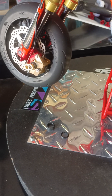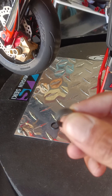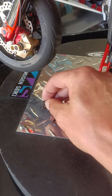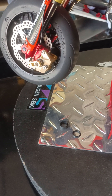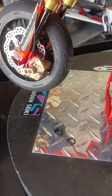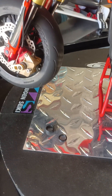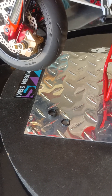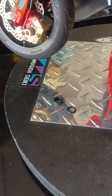In my opinion, from my background in engineering, design, and machining, we usually make these out of what's called Delrin plastic, which is the best plastic you can get, or in nylon — black nylon or white nylon. When we're racing European GP bikes, we use a nylon from Europe, preferably Italy, that is super smooth, super strong, lasts forever, and does not wear out. That's what Losi kind of should have put in there.